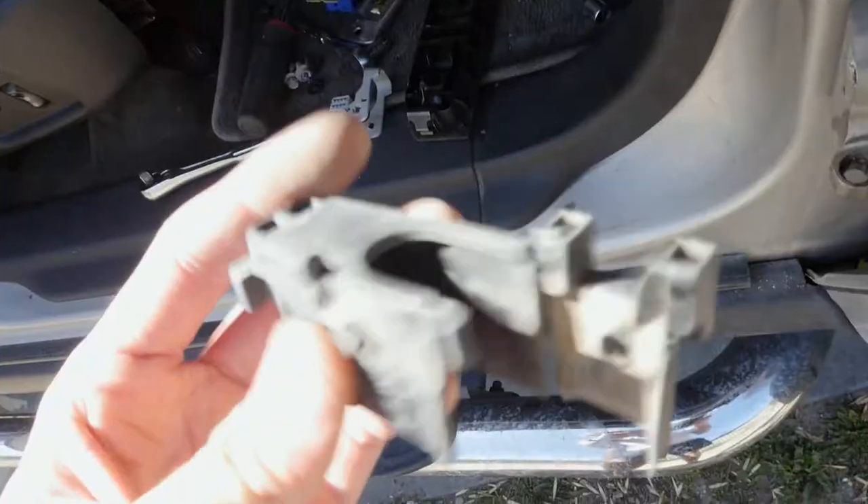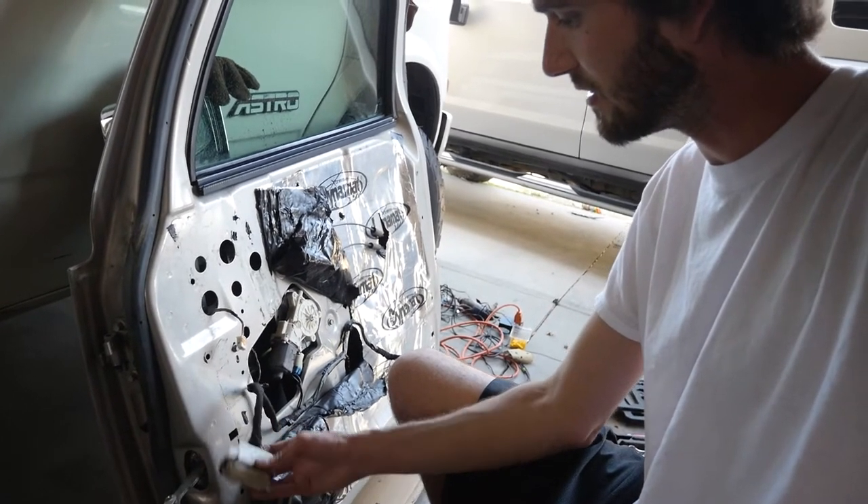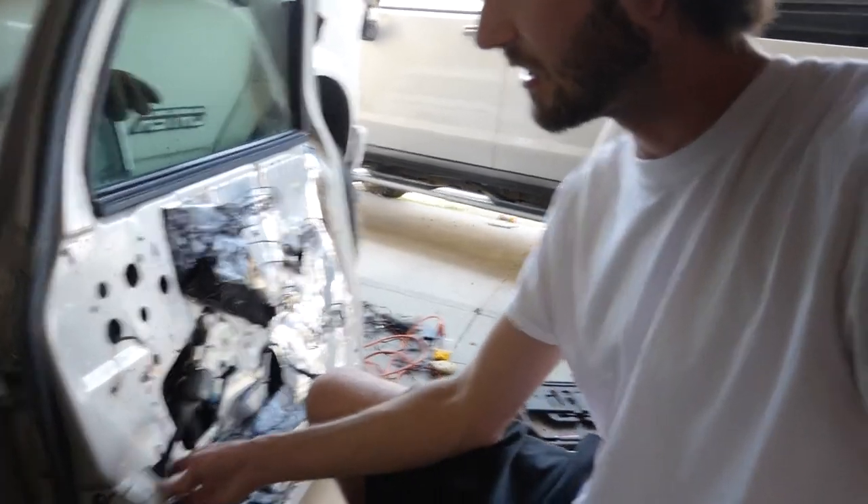I'm debating just making this connector work and keeping it waterproof. The downside is obviously I can't take the door off very easily without cutting all those wires. I plan on having AC in here and if I go off-roading I'm not just going to ditch my doors — they're in really good shape. So I think I'm just going to salvage this. I'll cut out this spot where all the connectors go and run the wires straight through, so I'll still have a sealed watertight connection.